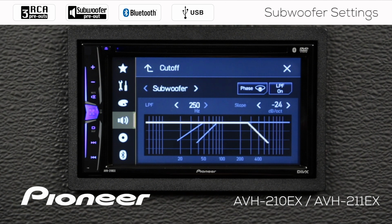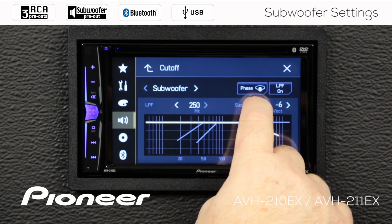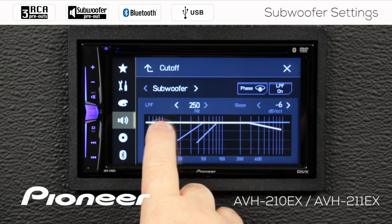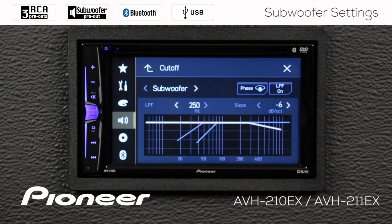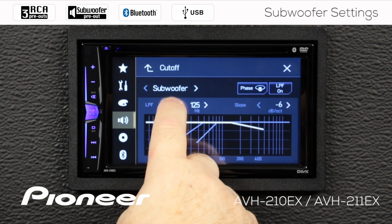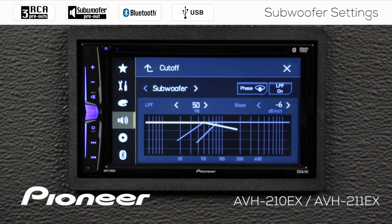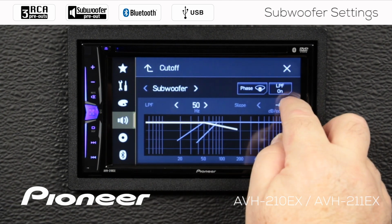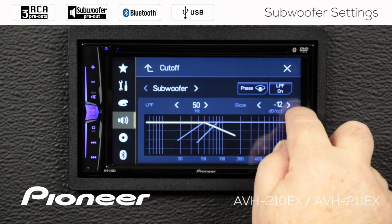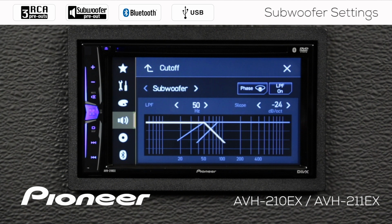slopes for that crossover: 30 dB, 24, 18, 12, or 6 dB per octave at any given crossover point. So for right now, I'm going to change this to 50 Hertz. There's my crossover point of 50 Hertz, and I'm going to change this to 24 dB per octave. There we go. There's my crossover point and slope for the subwoofer output.